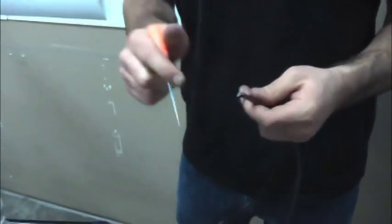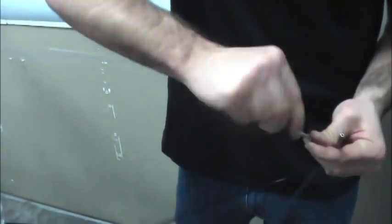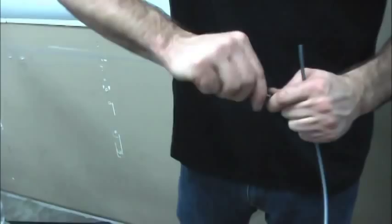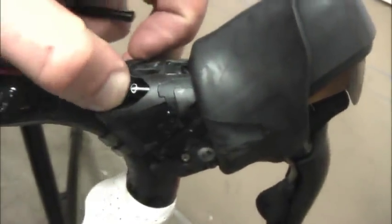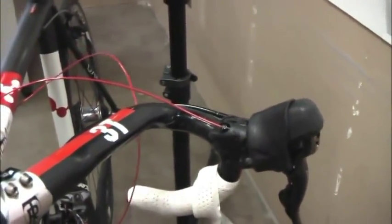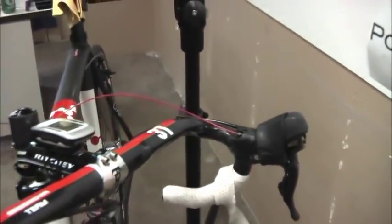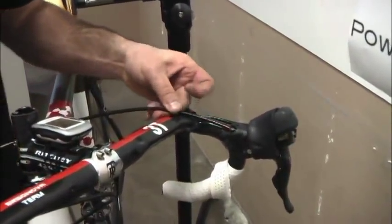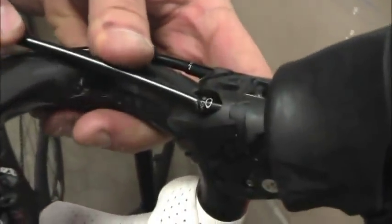Use an awl to clean out and re-round the housing ends. At the point of exit from the shifter, you will use the smaller 45-degree short-nosed ferrule to protect the cord. Then, insert the cords within the shift lever. Feed the cord through the power cord's prime housing and attach at the smaller 45-degree short-nosed ferrule.